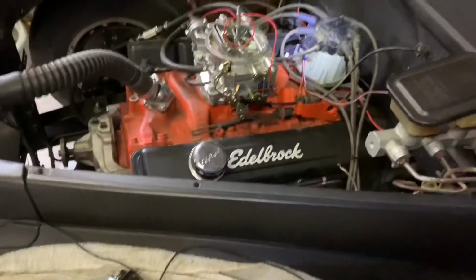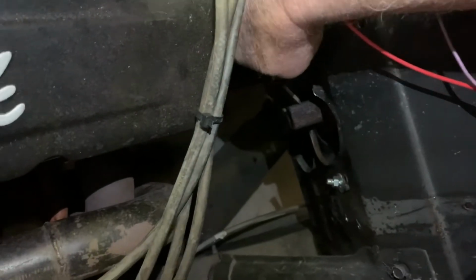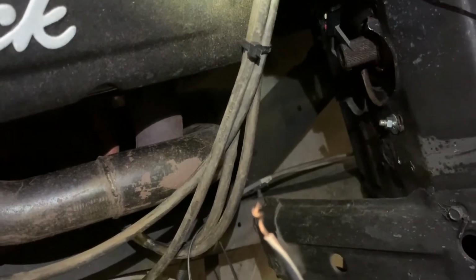Next, I've got to measure that steering shaft. So let me put you down for a minute while I grab my caliper. Sorry, I know it's dark, but I'll just be a second here. I'm coming back. All right, I have to measure that steering shaft that got out of the column so I know what U-joint to buy. I'm pretty sure it's 1 inch, but I don't know that for a fact. 0.99888 inches. I'm going to call that 1 inch.